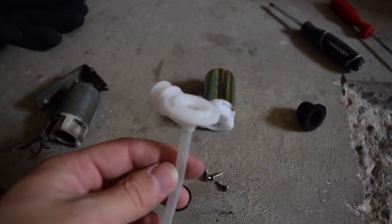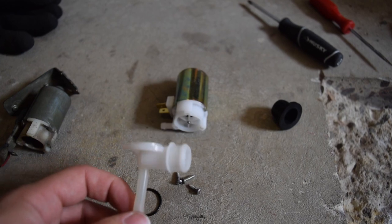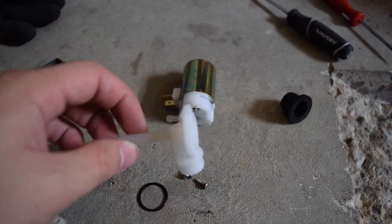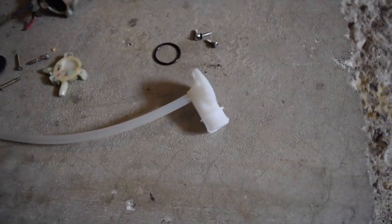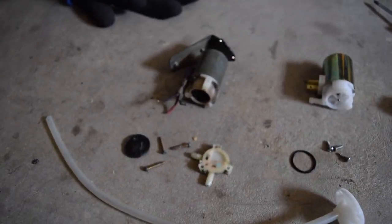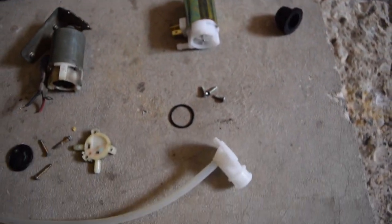So normally water would come through there and then up into it. What I did is I actually just bored it out very slightly — the drill bit I used was 7/32nds, but I might go up one step to 15/64ths or whatever that reduces down to. It fits pretty well. Whether it's watertight we'll have to figure out. I'm going to go with this because it lets us use both the front and rear washers. I'll go ahead and connect it to one of these nipples down here and see if we can make the washer work.